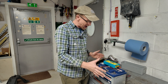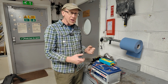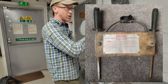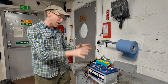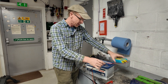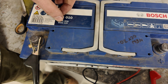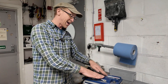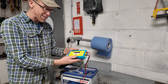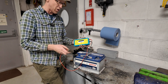We know a battery's got voltage — 12 volts, 12.6, 12.7 or whatever — but how do you measure how much energy is stored in a battery? It's really tricky. I remember as a kid going down the scrapyard where they'd put two prongs on it and sparks would fly. Every battery has a capacity: at the top here we've got 80 amp hours, meaning 80 amps will flow for one hour, or one amp for 80 hours. That's how much energy it can store. When these testers came out I remember thinking they're brilliant — I don't know how they do it.